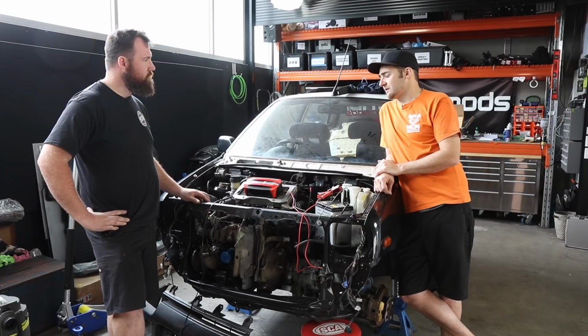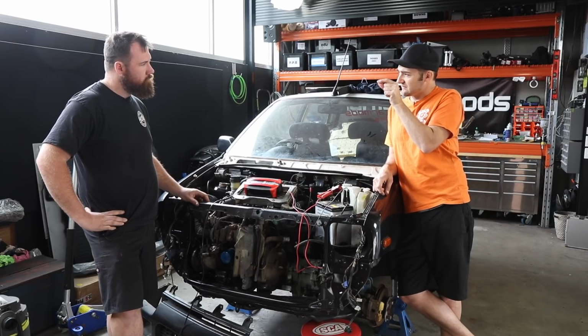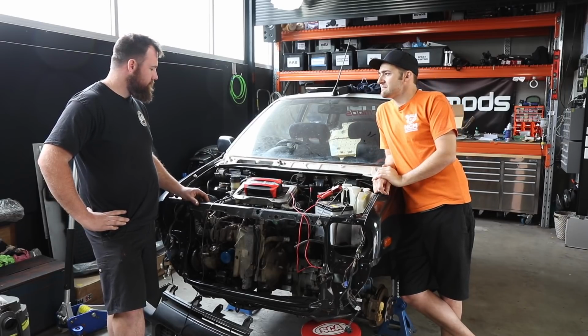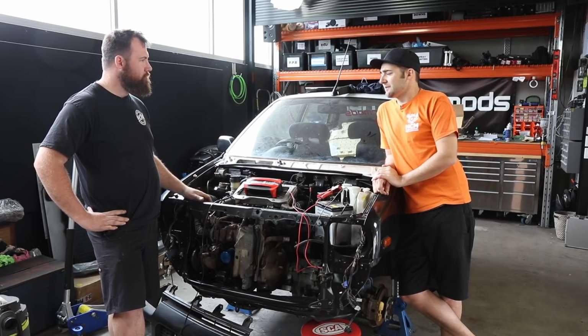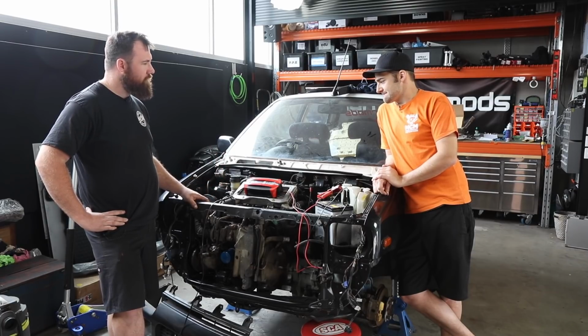But yeah, worst case, we can pull them out and try and force drive them in petrol or a cleaning solution. So when the fuel dries on the end of the injector, that little pintle thing, does it sort of act like glue and stick the needle in there? It's not necessarily the fuel itself. Sometimes it's more like the carbon and gunk, normally in the plenum. Oh, yeah. Whereas normally the fuel will wash that away from driving the car normally. But that'll just build up on the end of the injector and can stick it shut.